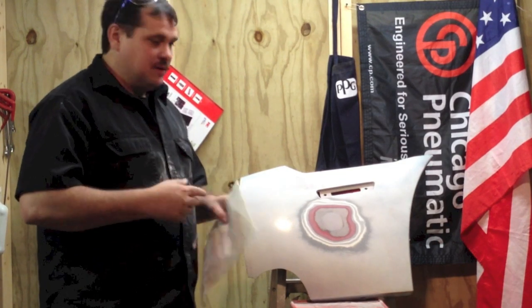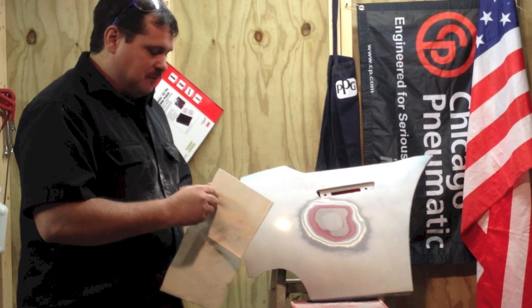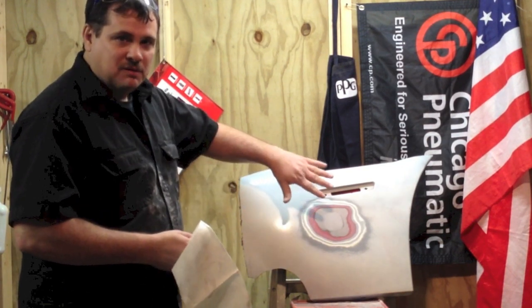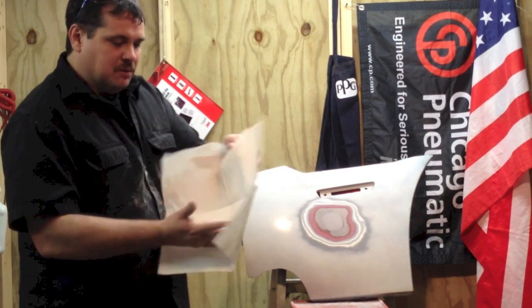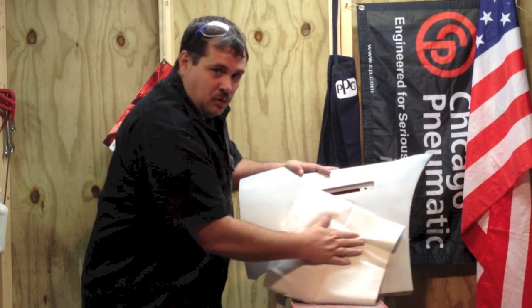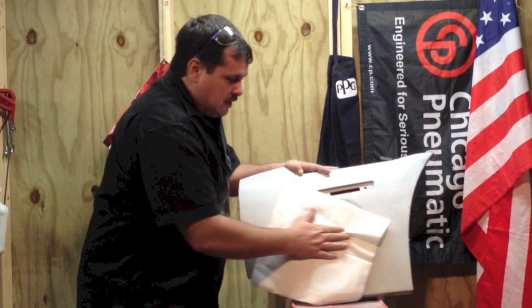And here's a trick for you. This is when using plastic repair or body filler, to kind of prevent from feeling all the different textures. Sometimes that gets confusing to determine if it's a high or a low. Use a rag, put it over your hand, feel of it. Sometimes you can feel more with that rag on there. If there's any waves, you need to keep sanding.